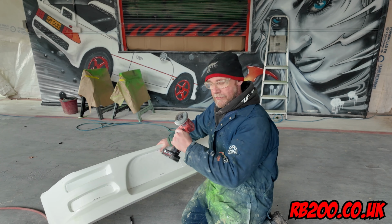Right, so he's given us permission to cut the back of this off. We can cut it there after that cross member, which takes off, I think it was 70 centimetres off the back end. Well, this needs to come forward 58 centimetres, or was it 50? I can't remember my measurements. Something like 58 centimetres forward for that wheel arch to be in the middle of the wheel. Yeah, looks like we're going to do that, but as is with the RBs, there's quite a lot of arch clearance. Because this is a race car and it's a little bit more rough and ready, what we might look at doing is putting those arch extensions on, the spats, but fixing them at a lower point, just to take up the arch space.